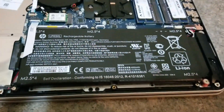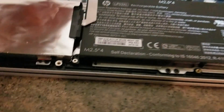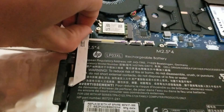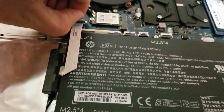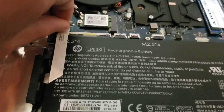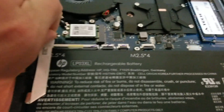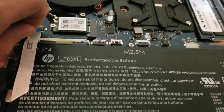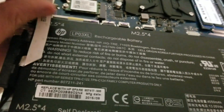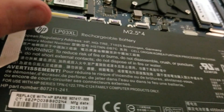And there's the battery! One thing I would recommend is disconnecting this ribbon cable here before attempting to remove the battery. So you want to carefully pry that hinge up and pull the ribbon cable out by the blue tab. And there is adhesive on the underside of the ribbon cable, so do be aware of that.